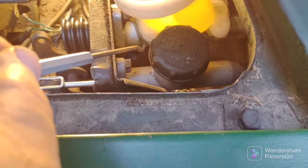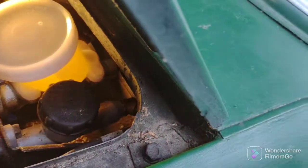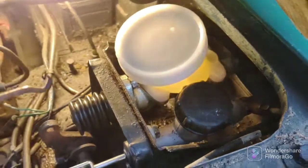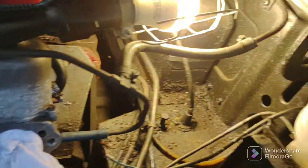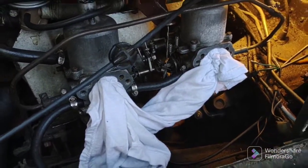When my helper was in the car guiding that bottom bolt in, I was in the engine bay using a captain hook tool to grip the threads and guide the bolt into the bottom mounting hole of the master cylinder. First make sure you have a clean shot and the holes are aligned. Slightly tighten the top bolt to keep it in place, then tighten both. Also, make sure you put something in your carbs - I saw a little dirt got in my back carb. These carbs face upward so they're very easy to catch dirt.